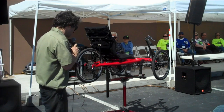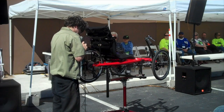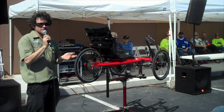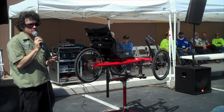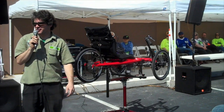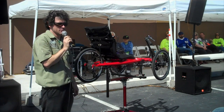You can sight down and look at the derailleur either from above or from behind, and it'll usually be pretty obvious that it's bent. And you can deal with the problem on your own. You can stick a 5mm Allen wrench in there and push it over if you have to do it in a hurry. It's not real precise to do it that way, but it could work.